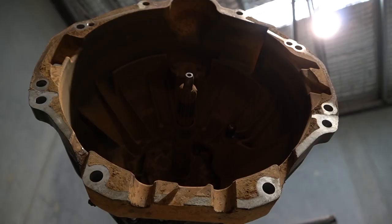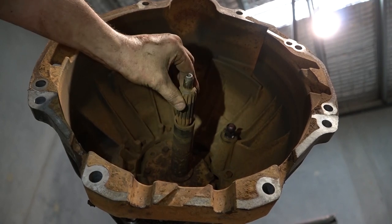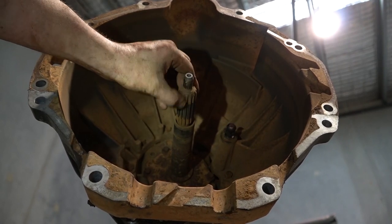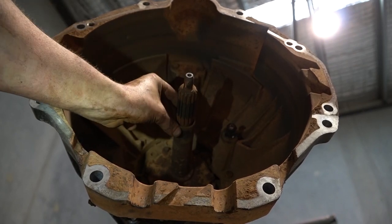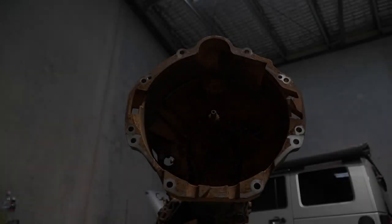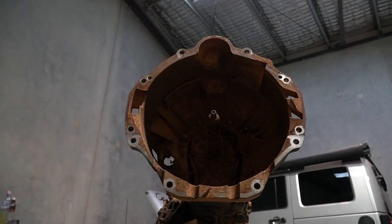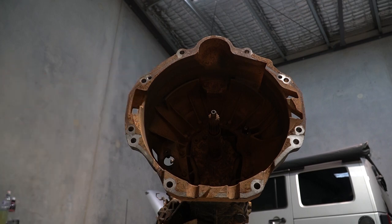By the wonders of a pathetic head torch you can now see this: the shaft with a spline that drives the clutch. This is going to be cleaned up and it'll need a little bit of grease on it. The bearing slides along this shaft here, so same applies to that. Anyway, now that my parts have arrived, I can go about putting this back together in the most convincing way possible — and then you'll finally realize what that ridiculous intro was all about.